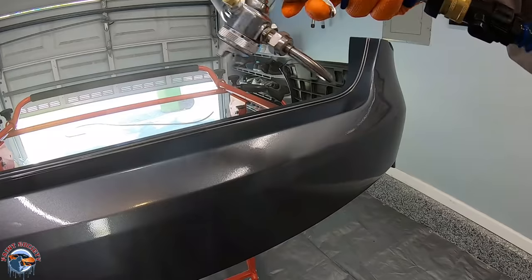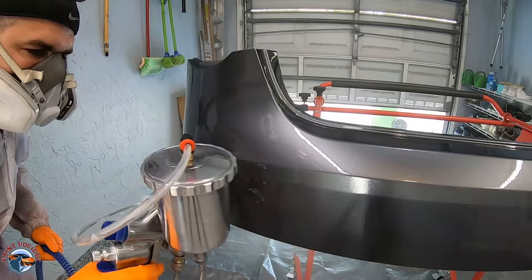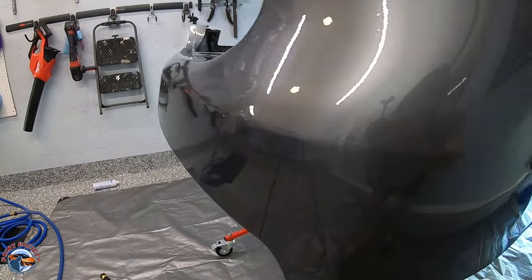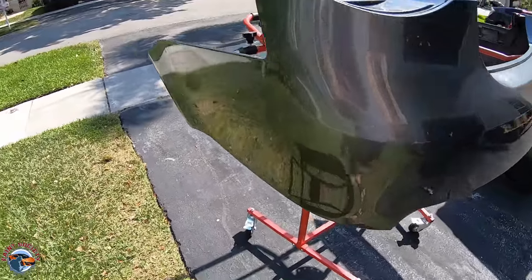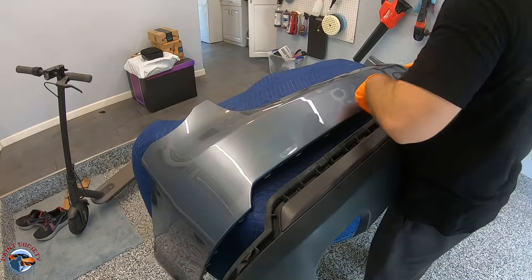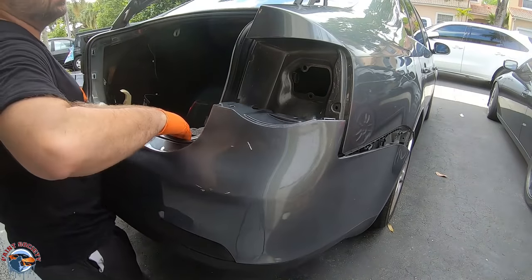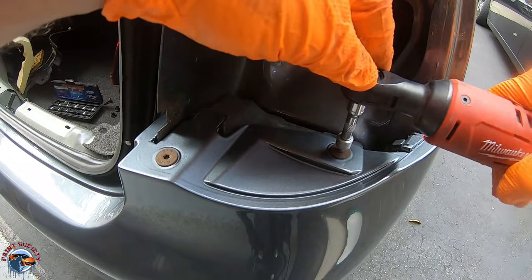I like to divide the bumper into about three or four quadrants, doing different sections at a time so I can focus — moving from top to bottom or bottom to top, it really doesn't matter. This bumper stand is a 3M bumper stand — it is awesome. I just built it and it does exactly what you need. It puts it up at a good height, and you can move it, tilt it, whatever you want to do — I highly recommend it. I'll put that link in the description. After it's dry, it looks pretty good — for a home garage, it looks great. We take it out in the sun and you can really see the metallics glisten. Nothing like seeing a fresh paint job in the sun — it looks really, really nice. We are ready to assemble — we let it dry overnight, taking careful pride and care when putting these together because we don't want to break anything at this point.